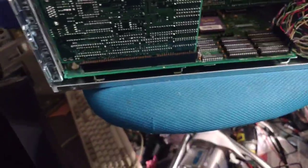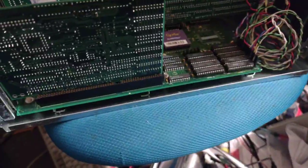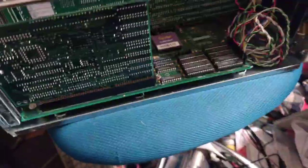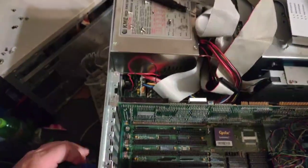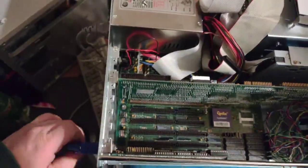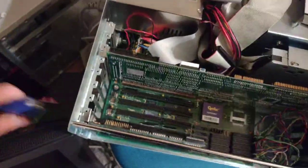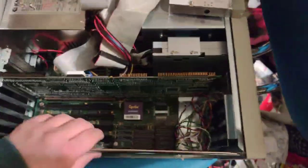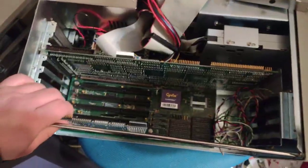Let's go and turn on again. I'm trying to figure out if it's because of a conflict somewhere. I don't know if it's a conflict from the sound card, the video card itself, or something else. But let's see what happens when I disconnect the video card here. It's probably going to do the infamous 2 small beeps and then 8 beeps. Let's see what happens.